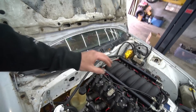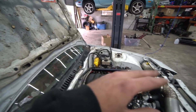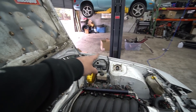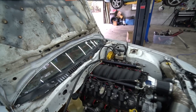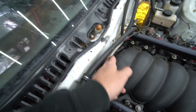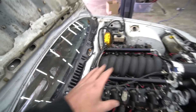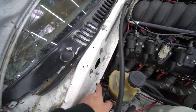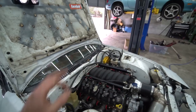The next thing we need to do is the oil pressure sensor. It had this really janky gauge in here with a one-wire sensor and it bounced all over the place — 120, 0, 20, 50 — all over the place. You can see that green wire right there. We've got to get that sensor out and get our new sensor in, but it's back here between the intake manifold and the firewall. Most likely the easiest way is to just pull the intake manifold off and move it forward so I have plenty of room, because this pinch weld here is really in the way.